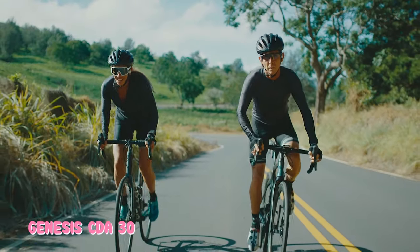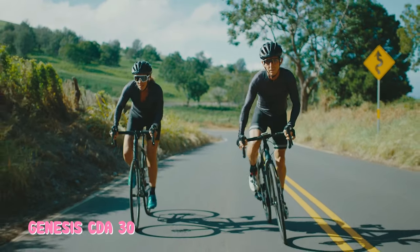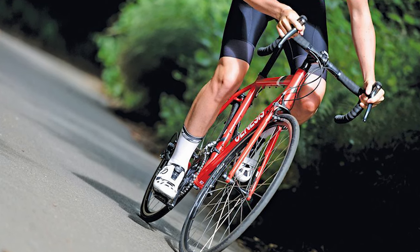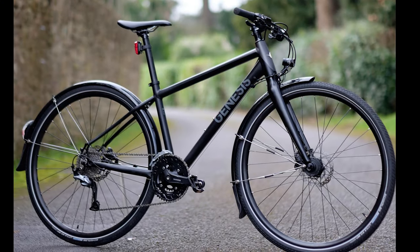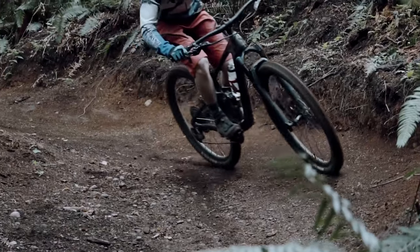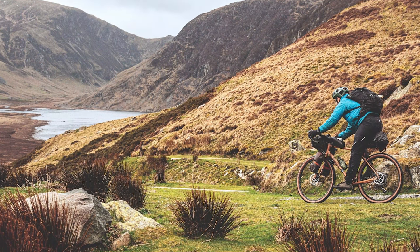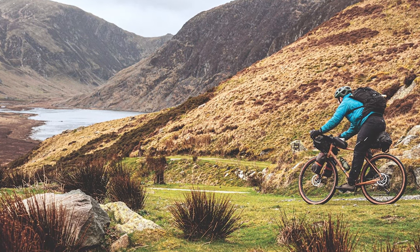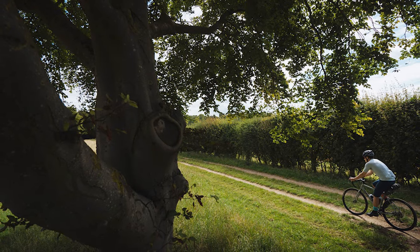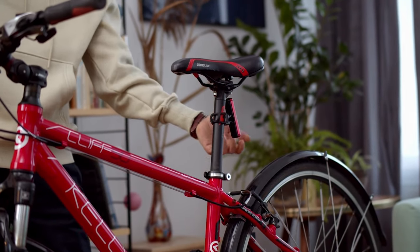The CDA does have an Achilles heel though, and that's the mechanical disc brakes. Even after what should have been a decent bedding-in period, they were pretty poor. We assessed the braking speed of all four test bikes, with the rider accelerating to 30 kph and then measuring the distance taken to stop. The Genesis was 4th of 4, at 4.73m versus 4.2m for the Boardman SLR 8.9. Fully loaded with Sainsbury's and Millets on board I'd definitely need a longer tape measure. Better pads might improve it a bit, but these brakes would still be nowhere near the level of hydraulic disc brakes — which are specced on mountain bikes at this price point — and it's a sorry state of affairs when rim brakes are superior.